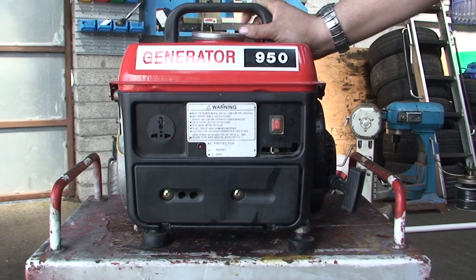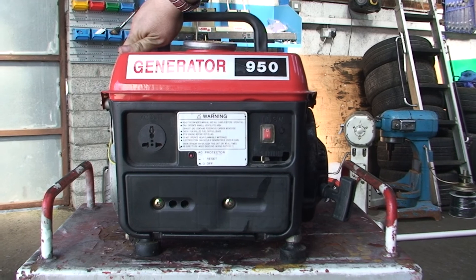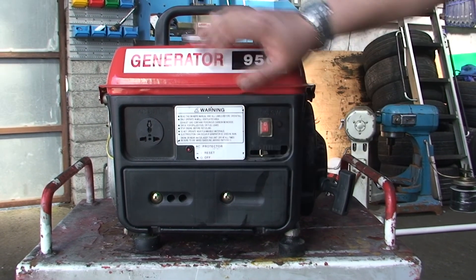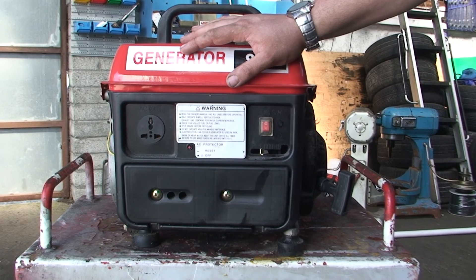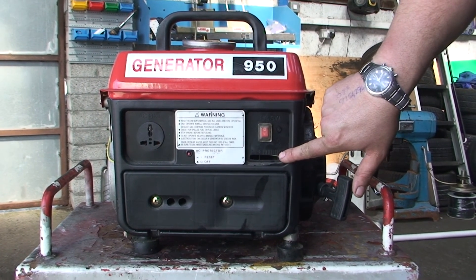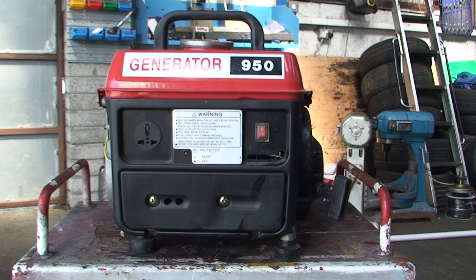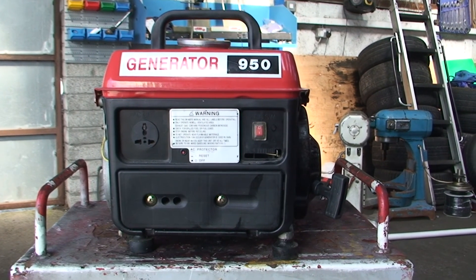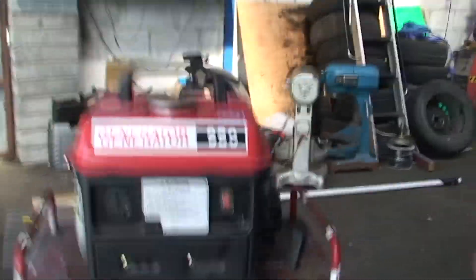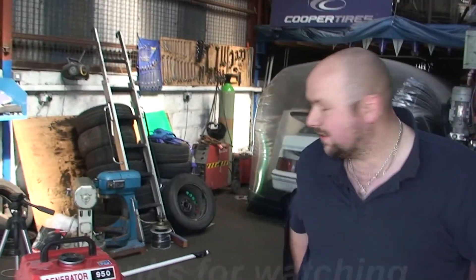As you can see, that's started. Don't be worried about the blue smoke because obviously it's a two-stroke engine. But once you've got it started, it's best just to leave it running for a few minutes. Take the choke off when you can. Leave it running for a few minutes just to get all the crap out of the engine. And that's it. So I hope this helps. Don't forget, get your hands dirty. See you for the next one.